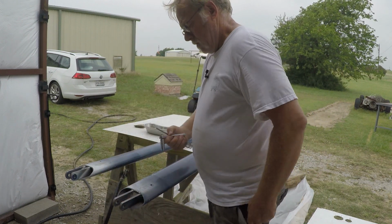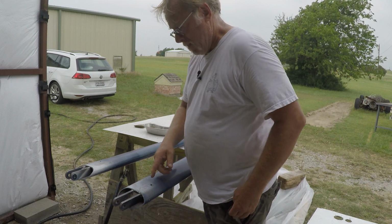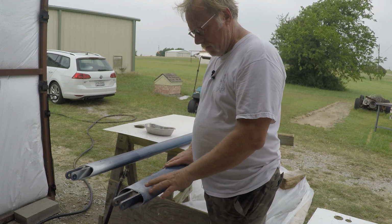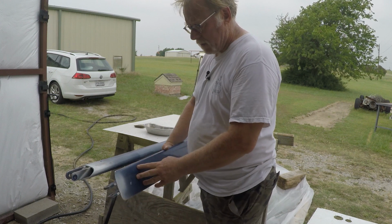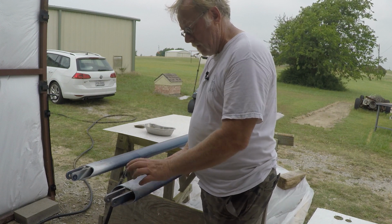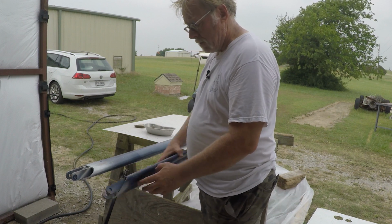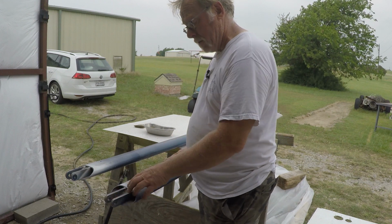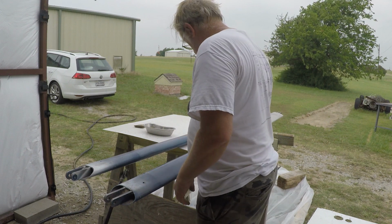Interesting thing on these tie down fittings is on the original Cessna 170s, the 170A I guess it was, when they first did the metal strut, single piece strut, these fasteners were high shear rivets, which is almost like a close tolerance bolt or a high lock bolt. After many, many years, they realized that was overkill. So they ended up changing those to aluminum rivets. So these are just aluminum rivets holding aluminum fittings. These fittings are replaceable and they are procurable from Cessna. So if you ever have a bad one, you can do that.